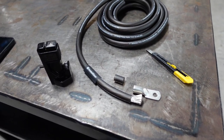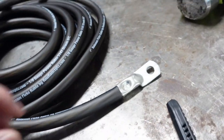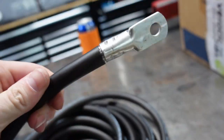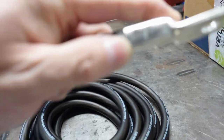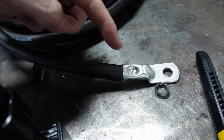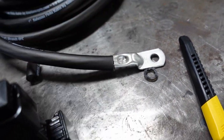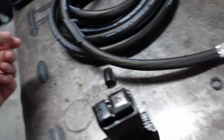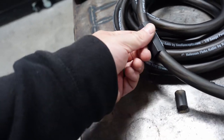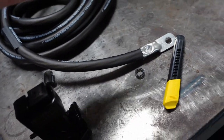I can use the other wire for other items I'm going to need in the future — it'd just be nice to have. So I'm going to finish this up here and show you guys as I install it. Once you stamp it, it has a little plus symbol — you'll see the marks on the backside too. I think I cut a little too much off because once you hit it, it pushes some out. But it's in there tight. Went ahead and did the vice test. Make sure you go ahead and sleeve it first. I'll torch it and shrink it up to it. Then you've got your ground — I'm going to run this the whole way up.